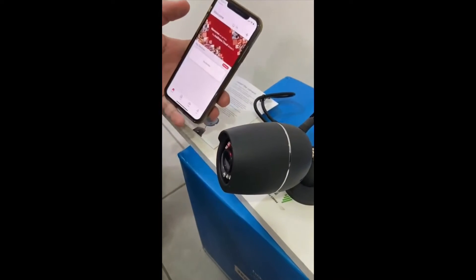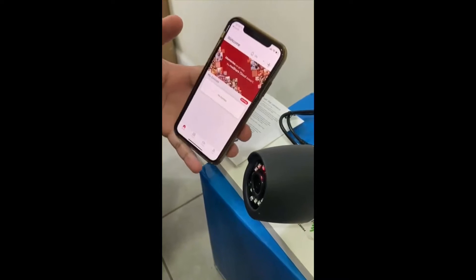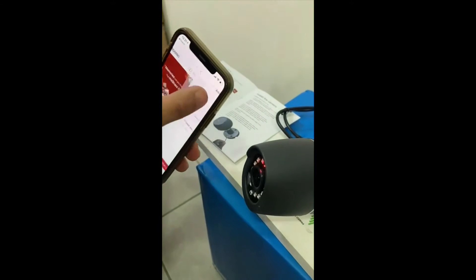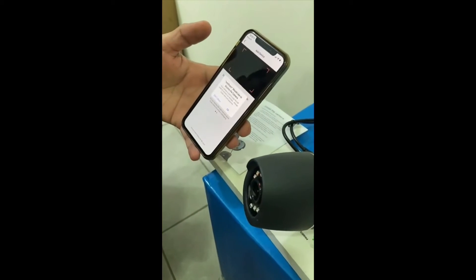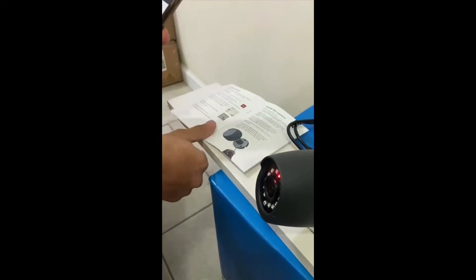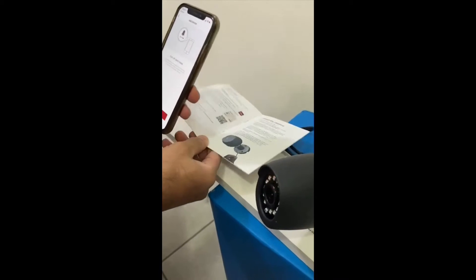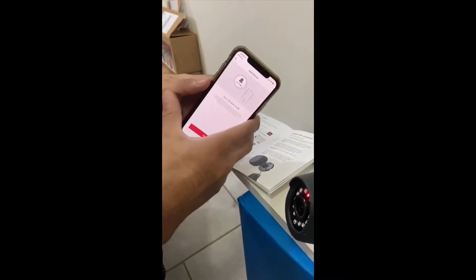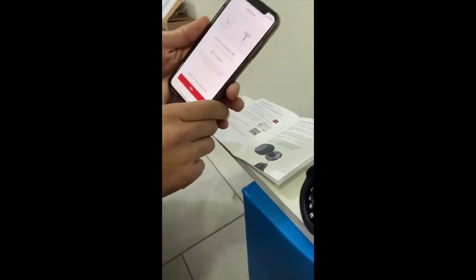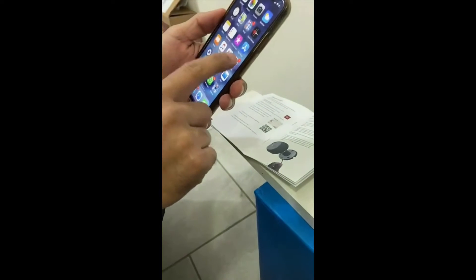This is the app that it comes with. I had just registered for the app — I was initially trying to register with a Hotmail account but it wasn't working, so I used my Gmail account and it worked. Maybe you have to have a Gmail account for the app to work. There's a QR code in the quick guide and it's asking me to scan it. Voice instructions are available but it's got to be off silent mode. I'm connecting my 5 GHz network and it's not compatible, so I'll change that to 2.4 GHz.